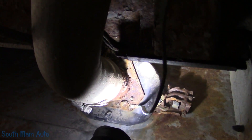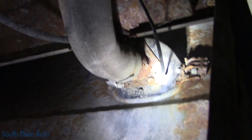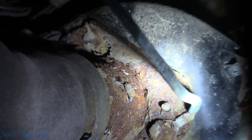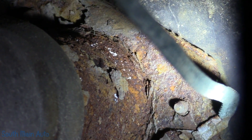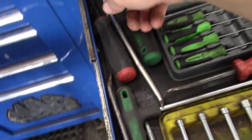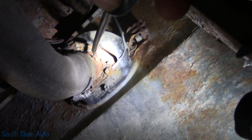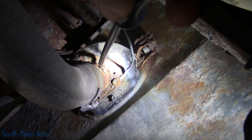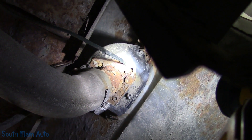I'm just going to get the soapy water — I don't think we need to. It could be the fact it has a giant freaking hole in the side of it. Let me zoom in — there it is. That looks like a big hole right there. I can see the smoke blasting out of it. The smoke is rolling out of that hole pretty good. Visual inspection — it has a giant hole. It is what it is. We know what's wrong. It's going to need a new filler neck or at least the upper half.